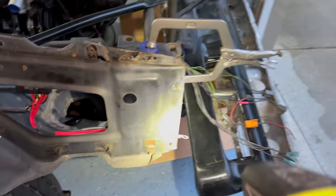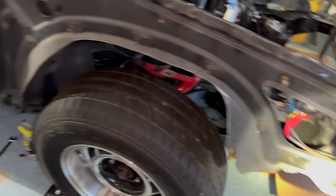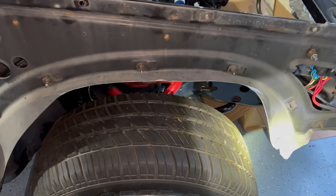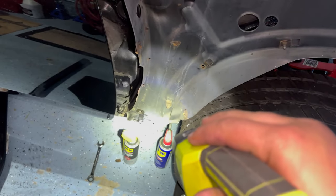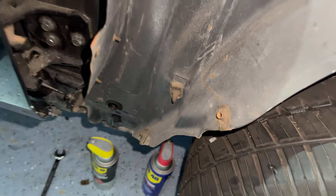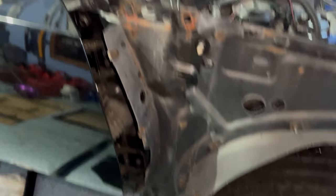You have some 10-millimeter bolts here that go to the inside of the fender. On the inside you're gonna have — I believe — another five or six like this, but I cut everything here in the middle because of how low my car sits. You can see some of the placements here. The light's not making it any better, so let's not use the light.